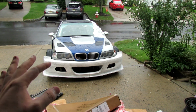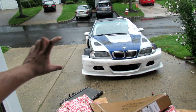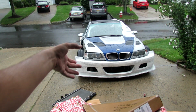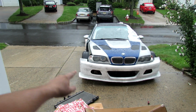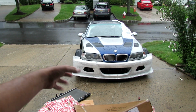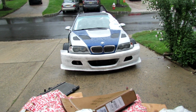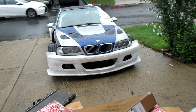I'm going to go to Home Depot one of these days, maybe after H2O, and find the ducts, the rectangular openings, and try to find one as big as that hole and rivet it from the back and paint it all black. Then run NACA hoses to the inside of the rotors for brake cooling, because I think that'll be a really good purpose-built thing for it.